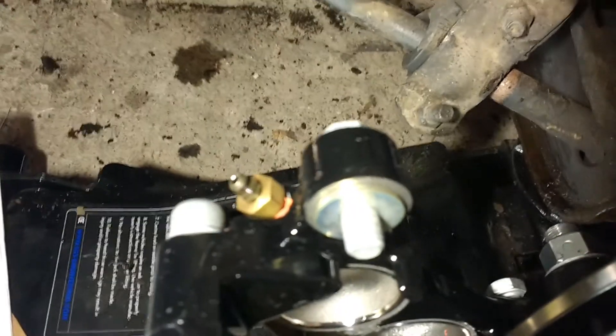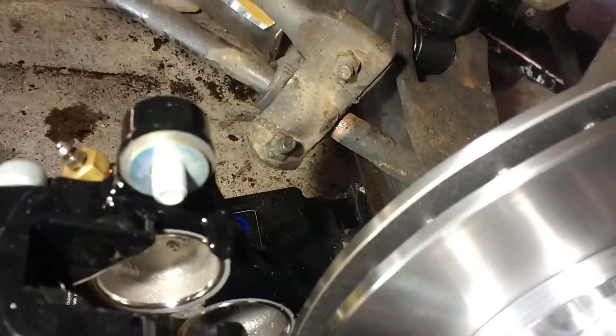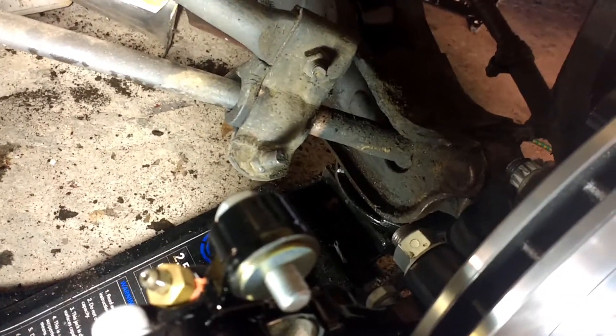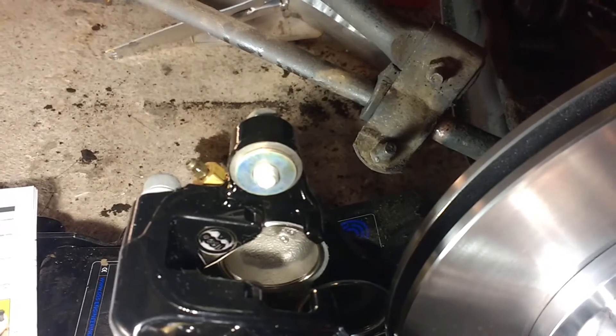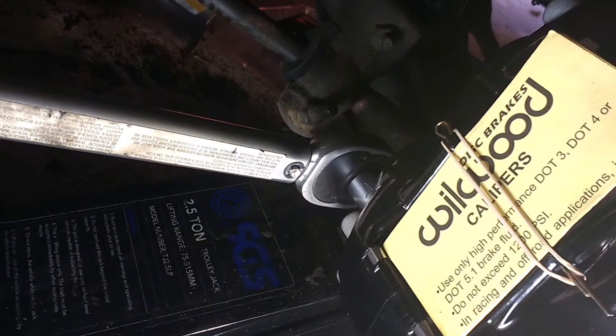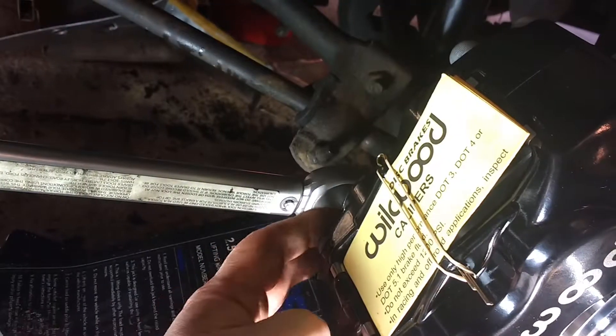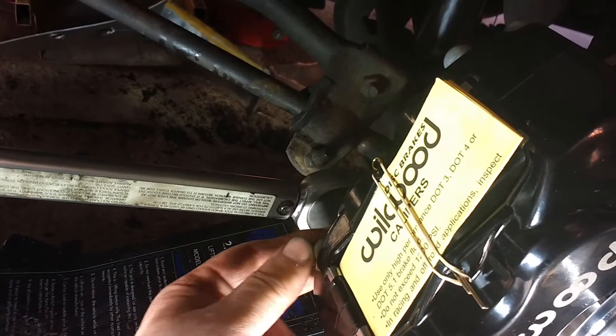There's the bolt with the washer on the back side and two large shims on the inside. We'll swing the caliper in and bolt it up to see how that looks. Test-fitted it — two shims is okay. I'm now going to put a bit of Loctite on the end of the threads of the bolt and do it up properly. I'm meant to do these up to 40 foot-pounds, and I certainly won't go higher than that because you've got clinch nuts pushed through an aluminium plate — I wouldn't want to damage those.